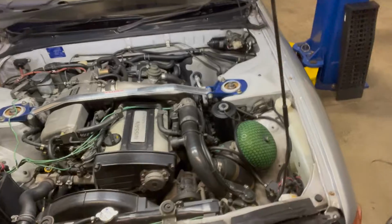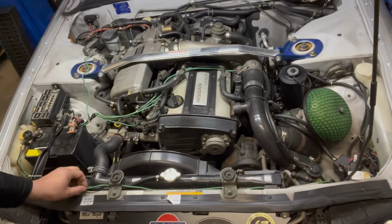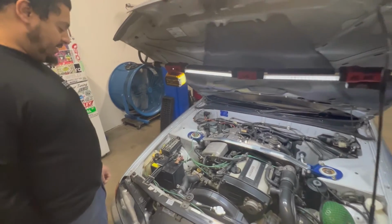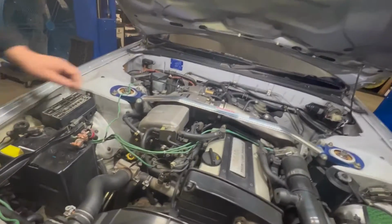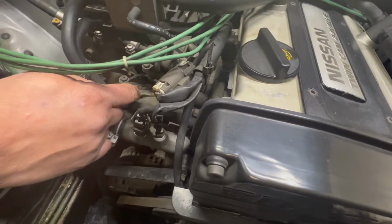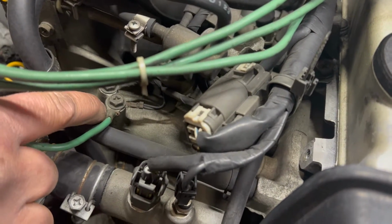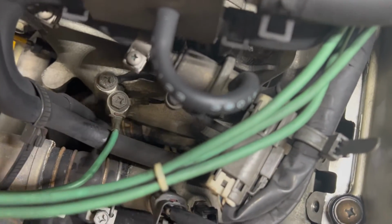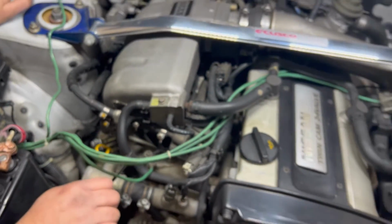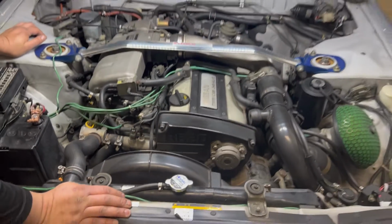and reliable. So we'll probably start with taking off this grounding kit, as it's pretty useless, especially with the way that it was installed. If you take a look at some of the ring terminals on this grounding kit, for instance this, it's actually crimped on the casing and not the actual wire, and it's like a home grounding wire because it's a solid core strand. So yeah, we're just gonna get rid of this crap, because for one, it never usually does anything. Doesn't really look great. It never looks great. It makes the engine bay look like spaghetti.